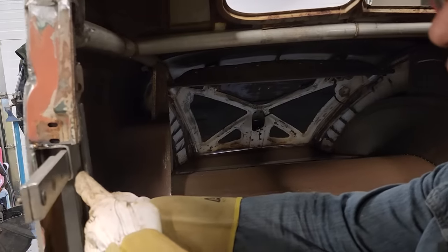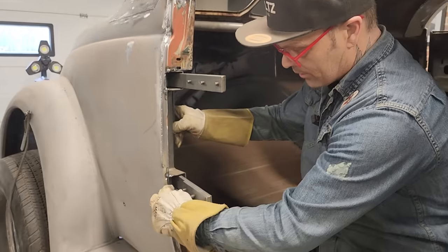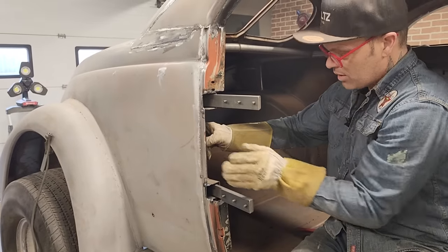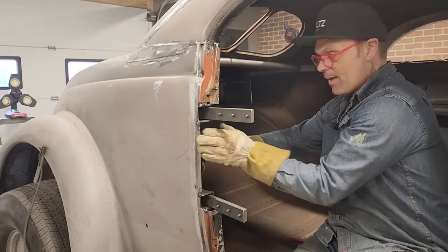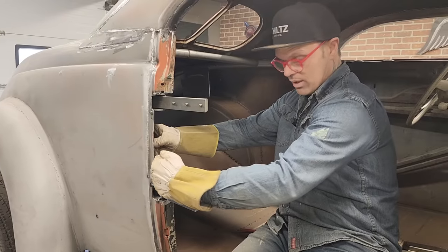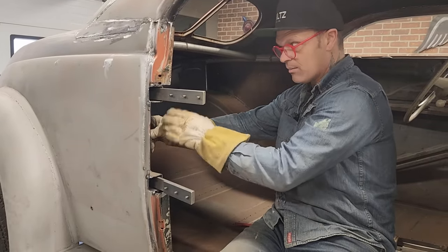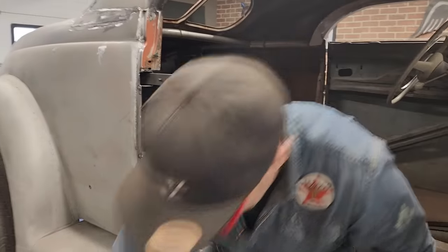And that way, that hinge will be nice and sturdy and will not go anywhere. We have to weld it all the way around here, put a piece on that, cap that, and connect it back together. Once we bring this back, we'll make a 90 on this side so it's nice and strong, and plus have this piece in the back side.